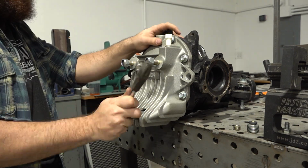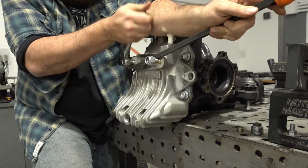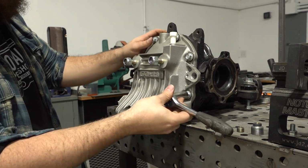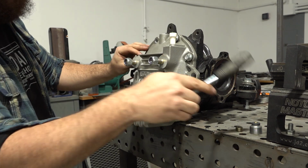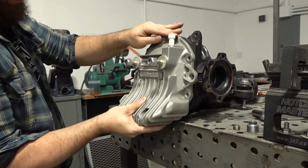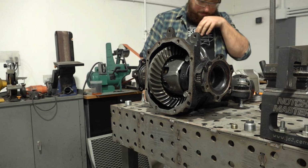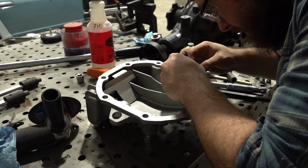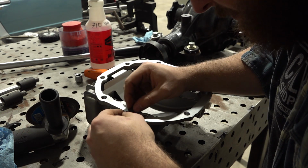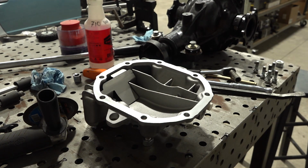There were a lot of Nissan differential options that could have been used for this restoration. I chose a short nose R200 from an R33 Nissan Skyline GTR. This differential is really interesting to me because it uses the same 6x1 31 spline output shafts as a 300ZX twin turbo, has a 4.11 rear gearing, and has a factory 2-way limited slip mechanical center. This should perform way better than a welded R200 from an Infiniti Q45 and is much stronger than anything that came factory in a 240SX. Additionally, it's 40 pounds lighter than the R230 differential found in a 300ZX twin turbo. At $400 on eBay, I thought this was a perfect package for the money for this build.